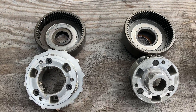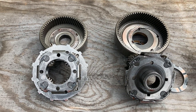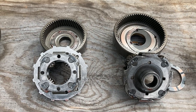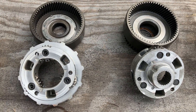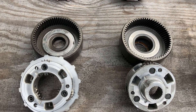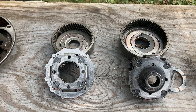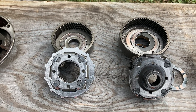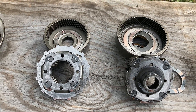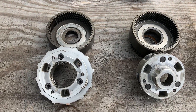For a 2,200-pound car with 200 horsepower, this seems like a no-brainer. The only thing that makes me think the wider ratio might be a good idea is because we're limited to that 4.10 gear in the rear end, and this engine really needs to rev to make power — 5,000 to 5,500 RPM to be in its happy place. The upside of the close-ratio aluminum set, in an application that's not going to destroy them, is they're light and they're closer ratio. You're looking at about another 400–500 RPM drop between gear changes, but it's about a 4.45–4.50 effective rear gear in first versus leaving with a 4.10 rear gear with the wide-ratio first gear. So the idea is it gets the car moving quicker and sooner, which is paramount in a car that doesn't have a lot of power. I'm looking for your guys' input — let me know, that could go either way.